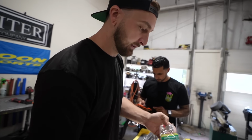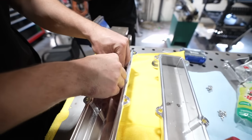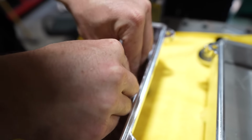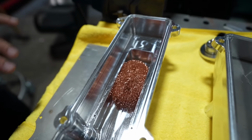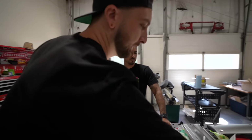And so I found this stuff, which is not wound so tight, and you can kind of feel the resistance versus the steel wool. Too much resistance, you still want air moving through it. So we're gonna put this kind of as a last resort of trying to keep some of the oil out of it, right? That'll give some surface tension to catch the oil and let it kind of fall back out, so. But it's security.